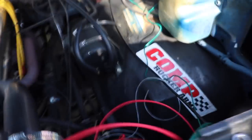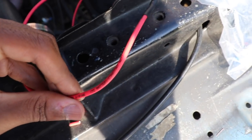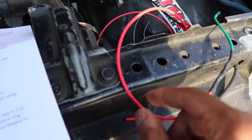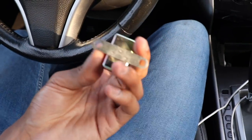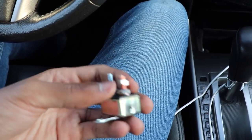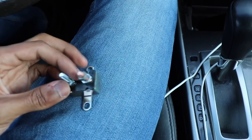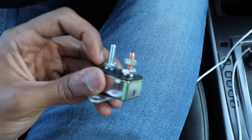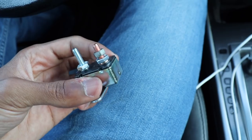Let's go ahead and get with this. Now we've got the power wire that actually came with the kit — as you can see, it's going to the battery or to the constant hot. It is going to go to a circuit breaker first and then into the constant hot. I've got to make sure I have a constant hot because I don't think I do. Then the gray wire goes into something that's powered by the ignition. The only thing I don't like about this Painless kit so far is the fact that it doesn't come with bolts at all. I'm going to need nuts to go over this so it will actually hold the wires down — and these don't come off, so I've got to find the little tiny nuts I need to put this together.